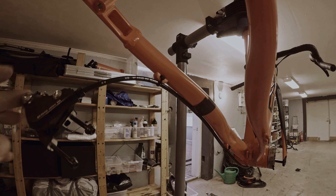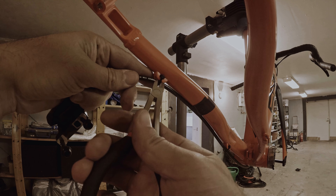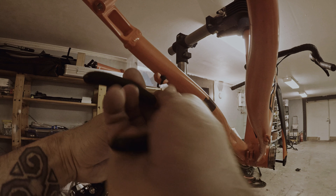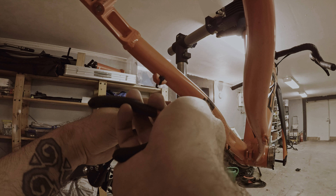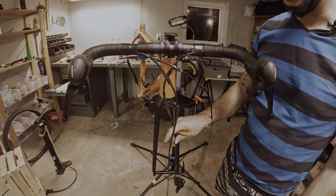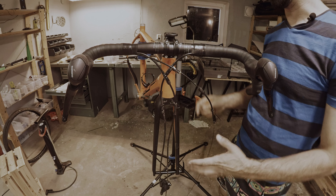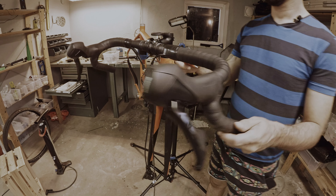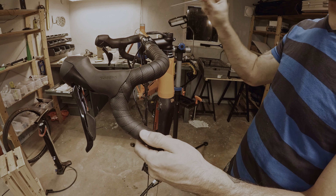When your brake caliper is free and hanging, you need to cut the cable loose before you can remove the fork. When doing this, be careful that you don't damage the cable. When your brakes and shifting gear are hanging free, it is safe and possible to remove the handlebar. To do this, you need to untighten the two screws in the stem and the top cap, starting by removing the top cap.